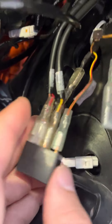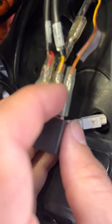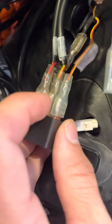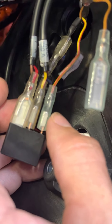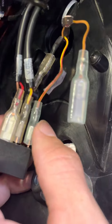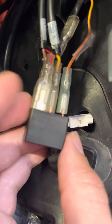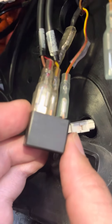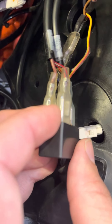Then on the vertical side of the relay, you're going to use the hot 10-amp line from ACC1 into one of those plugs, and on the other side you're going to use that extra female hot connector from the 12-volt adapter. Now when you turn the ignition on, it triggers the relay — like a gate door swinging open — to pass the 10-amp power through. So everything is powered by the 10-amp ACC1, but controlled by the ignition switch via the 1-amp ACC2.